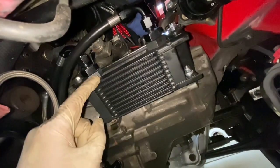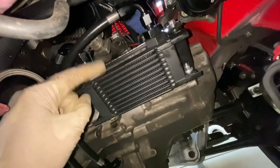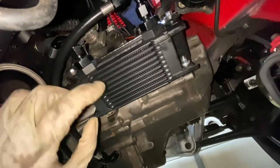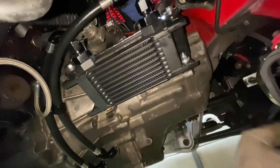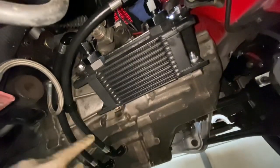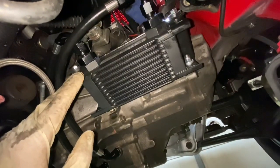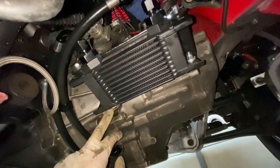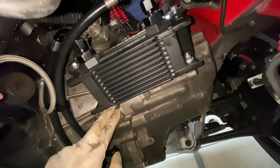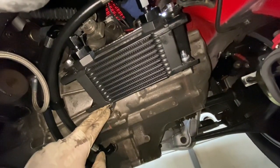So what the instruction on Alex Wilhelm's website said is same capacity plus 6 ounces usually. So the best thing to do is you fill it, run the oil pump, move the wheel back, so that way the internal oil pump can actually pump the fluid out. But he said usually about an additional 6 fluid ounces on top of the filler, pouring out this filler bolt right here. So the best is to fill it up, but it's still less than 4 quarts. All right, let's go ahead and fill it up, and then we're good to go.